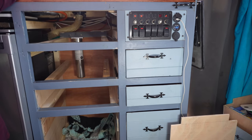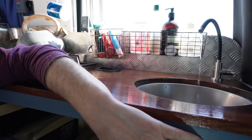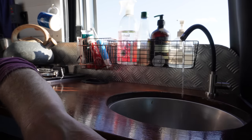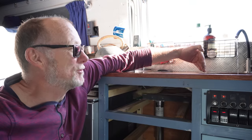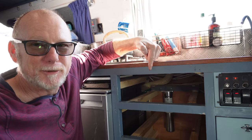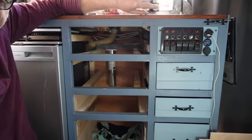I'll turn the pump off and turn the tap on to let any excess pressure out. As you can see there's still quite a bit of pressure. This system has an accumulator valve fitted, which keeps the water under pressure. If I don't release the pressure before undoing the filter, it's all just going to spurt out everywhere. Glad I remembered that — it stops now and there's just a tiny drip.